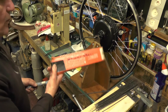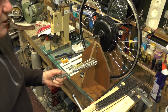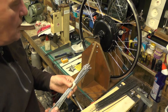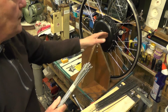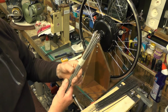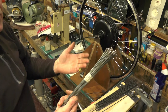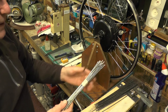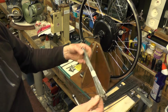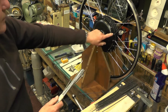I'm using stainless steel welding rods, 2.5mm. If you want to do this and you've got no facilities for putting threads on, what you could do if you can't find the size of spoke you need is buy a longer set of spokes. At present from China, delivered to your door, it's something like £12 or £15. You buy a longer set, utilise the nipple and thread end, leave that alone, cut the J-bend off to the length you want and put an S-bend on.